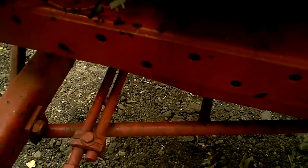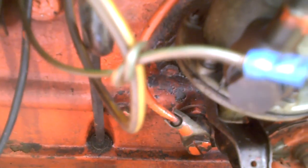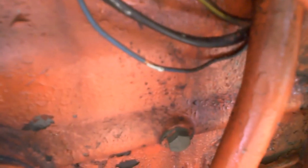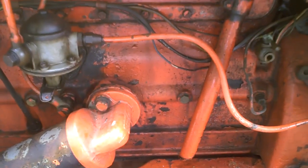Now I'm pretty sure I didn't do any damage with that, but now it won't regulate. All I've done is taken the cap off, and done the point. I've done nothing else. Now if you look at that wire there, which you can actually see now, it's all colours. I don't know if you can see that. Look, it goes blue to black, you see. So I had a black and what I thought was earth, but I got those two wrong. That's why it wasn't charging.